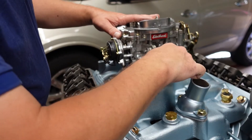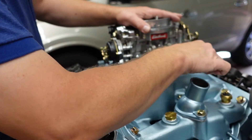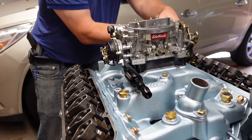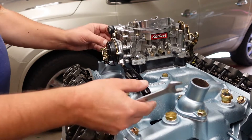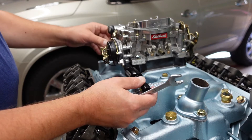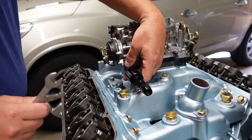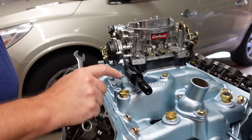These do not have to be that tight — just enough to compress the gasket and the plastic a little bit; that should make a sufficient seal. Don't get crazy. Like I said, I still hadn't tightened up on the banjo fitting here, so we will get this filter on and get it tightened.